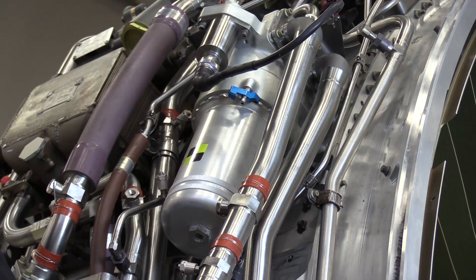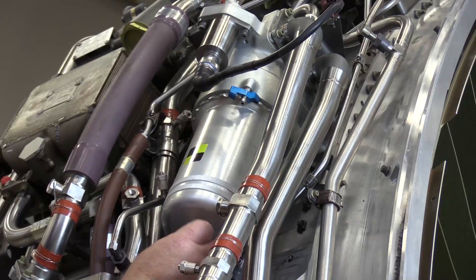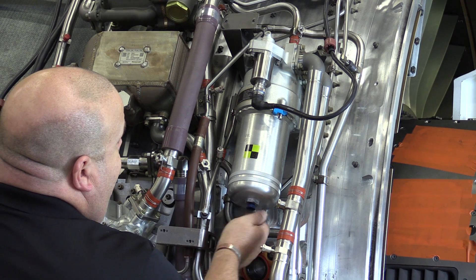As with all procedures, we want to be sure to consult and follow the proper AMM procedure. I've taken the liberty of cutting the safety wire and removing the drain plug to drain any excess fuel that might be left in the filter bowl. I have removed the old packing from the drain plug and installed the new packing properly and lubricated it with Vaseline. So we're going to go ahead and install that drain plug again.